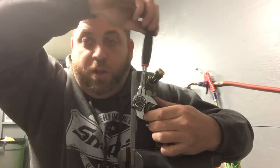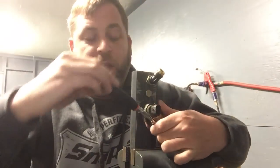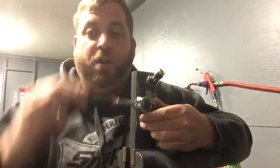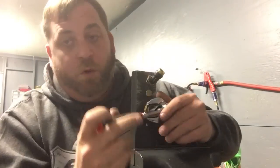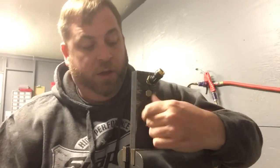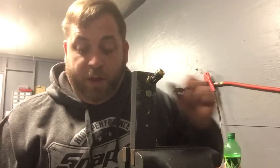With the crow's foot, you put your extension on — or use it without one — attach your ratchet, and if you can only get on it straight down, you just turn it loose and keep coming back to it. If you have enough room to swing all the way around, just move your ratchet around and with a longer extension you can keep going all the way. That's how crow's feet work here — you can reach down there and spin the sending unit out, and it works for tightening too.